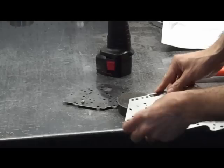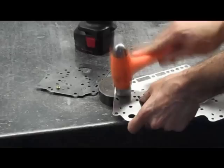Now when you put the plug in, you want a real hard flat surface. This plug comes in the shift kit. So what you're going to want to do is lay the plug down on your flat surface. You want to get this side of the separator plate because it goes up against the trans case - this is going to save you some trouble. Put this down over the plug, and we're always going to start from the other side. That's going to expand the plug into that hole, and you want to make sure it's in there nice and tight.